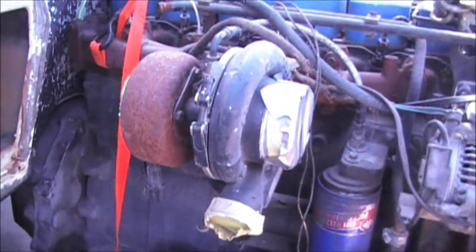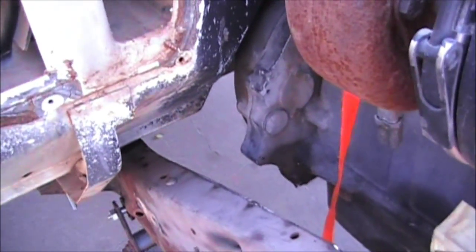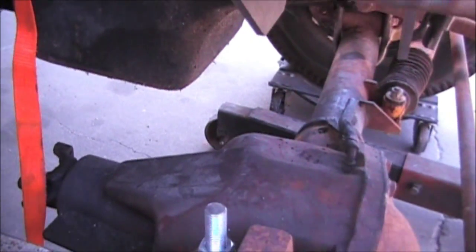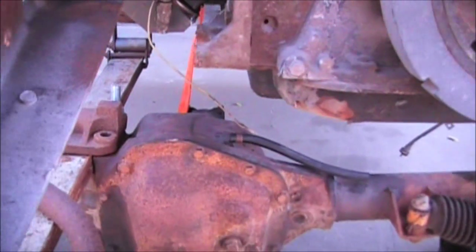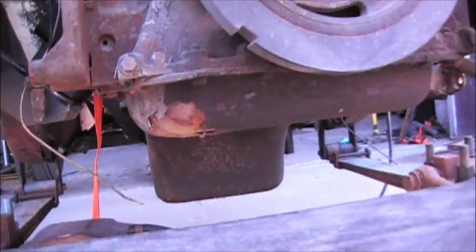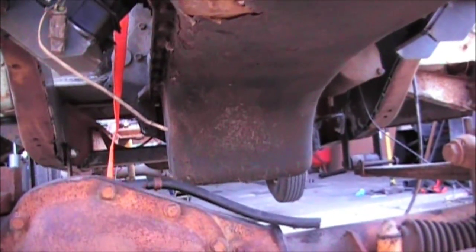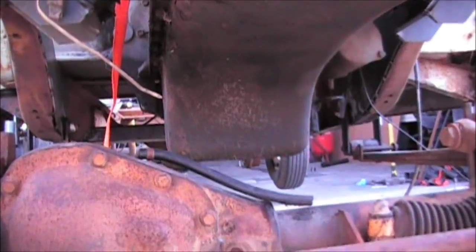But again, if you look at the angle here, we've got plenty of room for the hood to fit over it. I'm really happy where it's sitting. The other issue I was a little bit concerned with is whether the exhaust was going to fit down through there, but we've got plenty of room for the exhaust as well. So I don't think I'm going to have any issues getting this truck to run and run right. I was a little bit concerned about clearance between the oil pan and the pumpkin, but it looks like we're going to have plenty of room there. Also, keep in mind that this thing is going to get a different set of springs, which is going to open that distance up a little bit more. I was a bit worried about the angle of the drive shaft as well, but you can see it's going to clear the drive shaft — it's going to have a couple inches that can come over if it starts to articulate. That Dana 60 is a pretty big pumpkin and the Cummins naturally has a huge oil pan. If it really does start to become an issue, I will probably build a custom oil pan with an offset sump, or I may just cut the corner out of this one and weld a corner in that allows it to clear there. But I've got plenty of time to worry about that further on down the road.